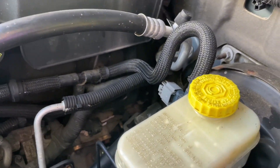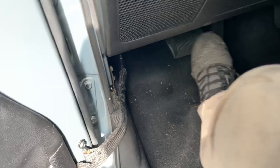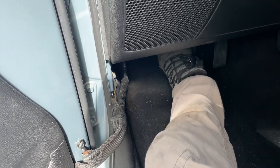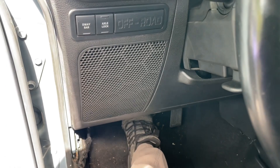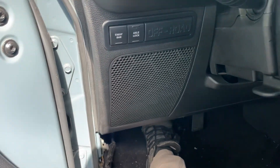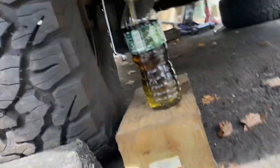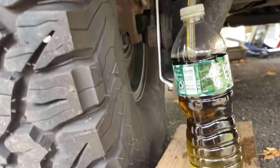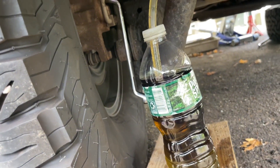You have to make sure you don't let the reservoir dry out. Now I'll be pumping the brakes and I'm going to keep bleeding until I see the clear brake fluid come out from the bleeder. As you can see it's clearing up - I'm going to pour out these because it's almost filled right there.